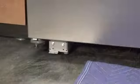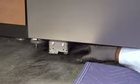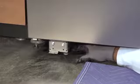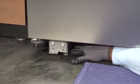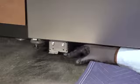Go back to your four leveler assemblies and lower the four locking legs that secure the unit in position to prevent movement during usage. Place the toe kick on the four hooks at the front of the leveler assemblies and slowly lean it back until you feel the magnets grab and hold the toe kick in place.